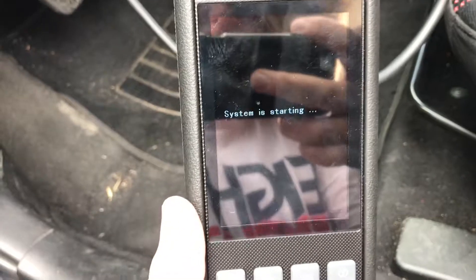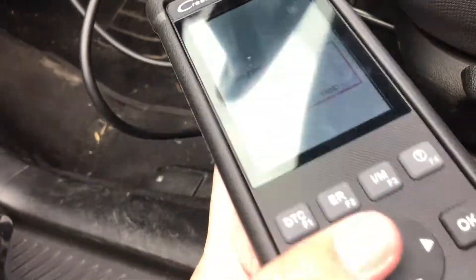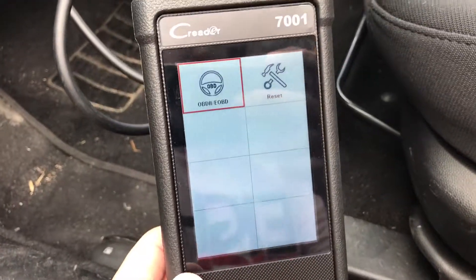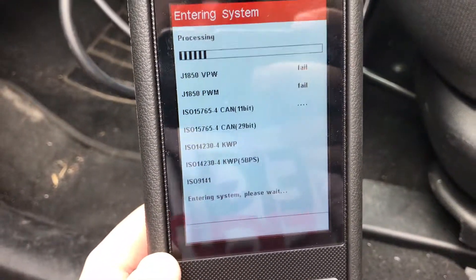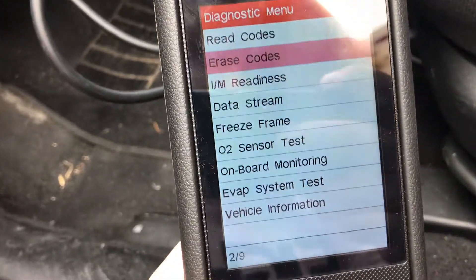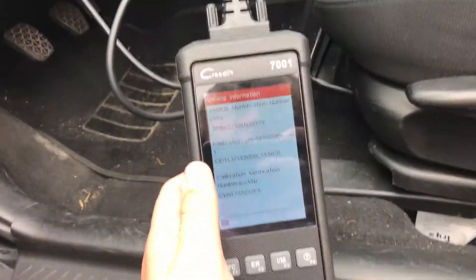Alright, here is the home screen — it's really cool and actually a very helpful interface. Usually when I work on car-related stuff like this the interfaces are kind of terrible, but this is really not bad. We're going to go into the diagnose menu, press OK, and you can reset everything or go into OBD2. Right now it's going to enter the system and scan everything. Once it's done it gives you this screen and you can get in. You can even see the VIN right on here, just to make sure all the details match so you know exactly what you're getting into.